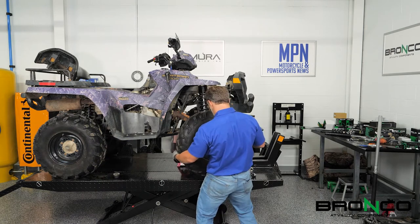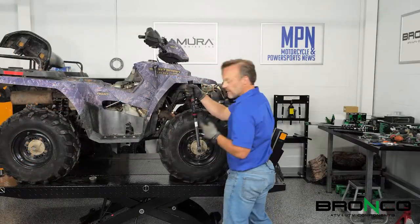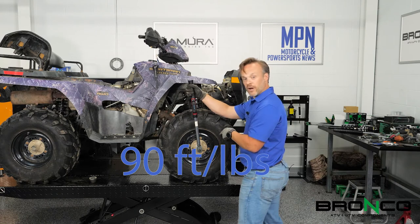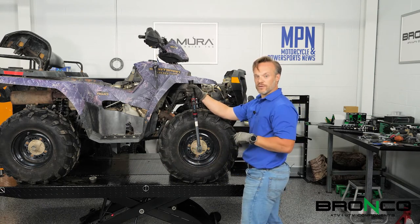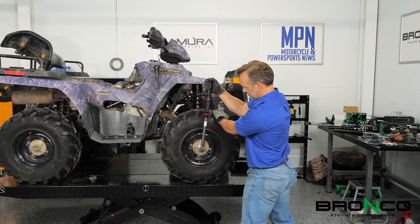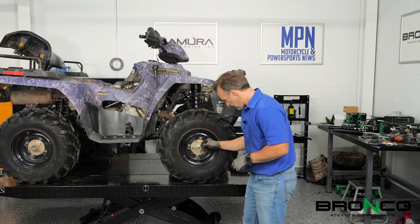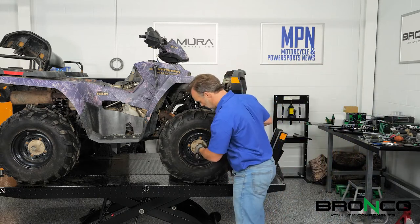Next up, wheel and tire go back on. Now that it's on the ground and we've got a stable platform and can use the leverage of the four-wheeler against it, 90 foot-pounds for the hub nut — that's to make sure we don't crush that wheel bearing, but I also really don't want to go chasing my wheel, tire, and hub assembly down the trail. I said something earlier about new cotter keys — same thing here. And now finally the cover, because we know it's on there.